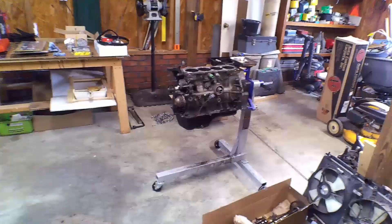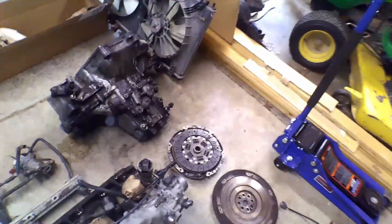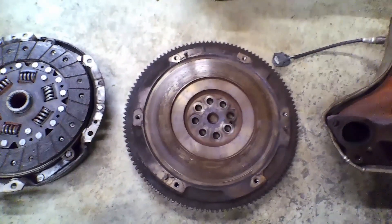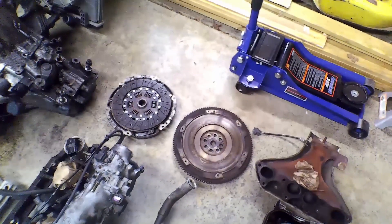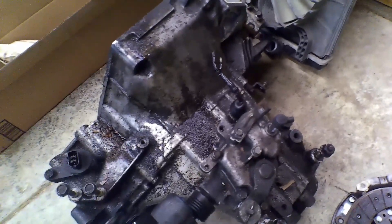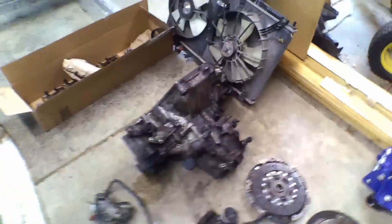That's what got us here today. About a year ago I replaced the clutch on the five-speed manual transmission — the clutch itself still looks brand new — but I did not get the flywheel resurfaced. Once I got everything back together, when you engage or disengage the clutch you feel that chatter, which is indicative of a flywheel that's not surfaced right. So rather than just pull the transmission, I decided to take the whole engine out. On top of that, the engine developed an oil leak out of the distributor — there's an O-ring that sits in there. It was clean a year ago and you can see how bad it is now.